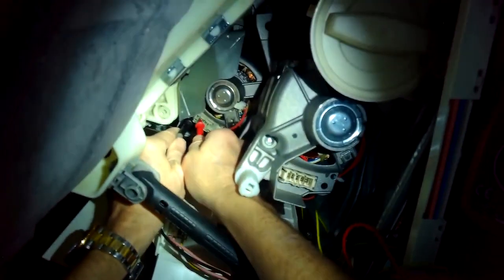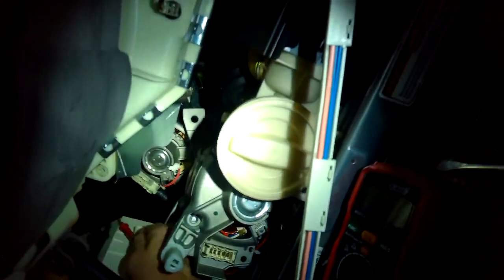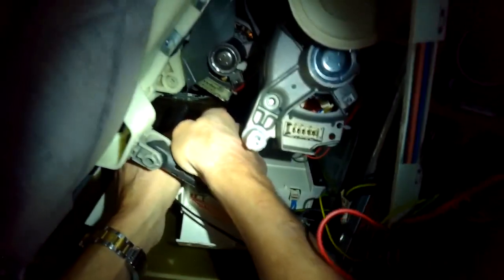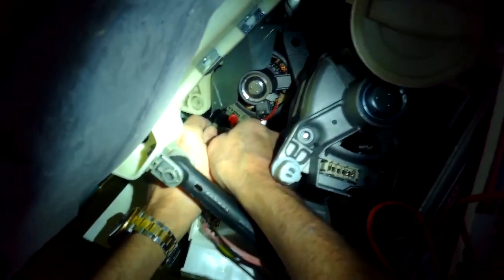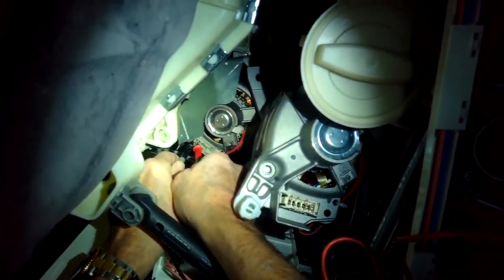Checking the existing motor: the first two pins also gave me 5.9, but the next two pins down should have been the same value — it was just open, showing no continuity. So that circuit had burned up. On the new motor I got 5.9 on both the top two and bottom two, and on both motors the very bottom two gave about 114 ohms. So I think just half of the old motor got burned out.